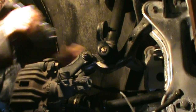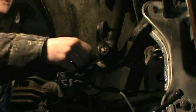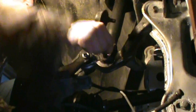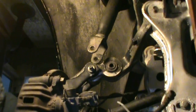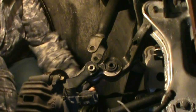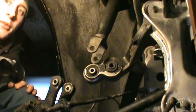I'll try not to block it too much with my hands - just unbolt the top of the hub here. It's just those two bolts there, so pop those out and see how we make it. So that sits down now, and I should be able to tilt her right back a bit. That moves the axle back quite a bit there, so hopefully I have enough room to slip her in place.